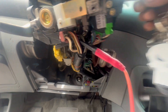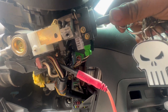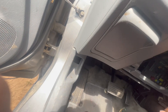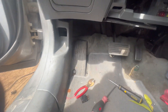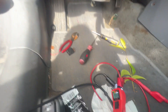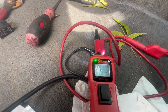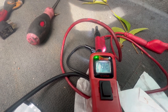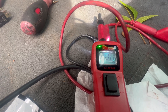Now what I'm going to do is open the ignition switch. Right now it's in second position — third position is when you crank it. You can hear that noise. What we see right here — let me hold on — this is what happens when we crank it: the wire that sends the signal to the relay and starter is cutting off power. Not enough — it shows voltage but only about three or four volts, which is not enough to activate the relay.